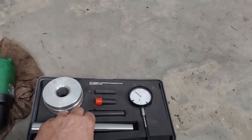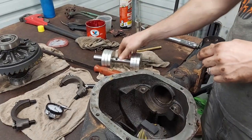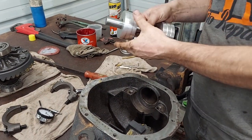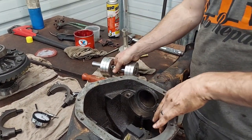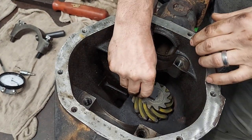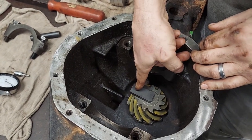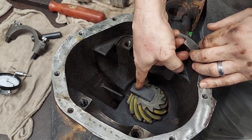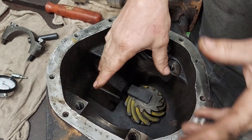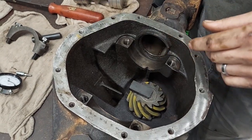The first thing you want to do: you've got the bar, you've got your fake bearings. You want to put your target plate in here — this magnetic base right here. Set it on that pinion because here's your centerline, so you can measure off of something. That'll get the dial measuring off of this flat surface and you'll sweep it back and forth. Go with the highest number and that'll be the correct reading.